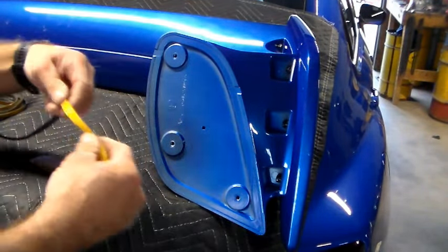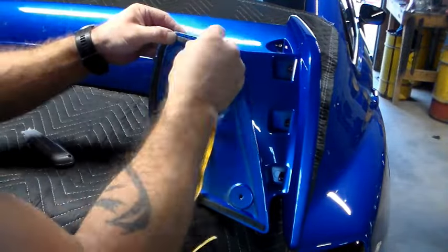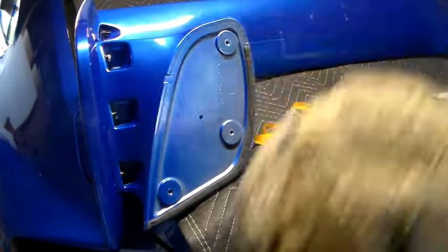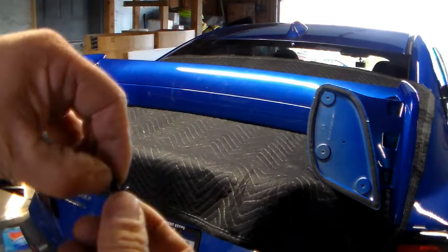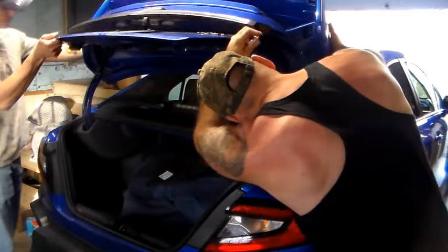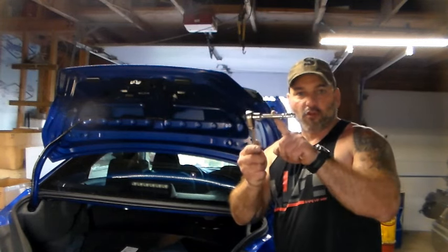Before bolting the wing down, we're going to apply the adhesive foam — best done in two pieces, up around the long side and then the other side. Once the foam is on, we're ready to bolt it down. The bolt order is crush washer then flat washer. For tightening, a 3 or 4 inch extension with a shallow 10 millimeter and a ratchet is the best way to go. Magnetic bits are definitely helpful — if not, have a magnetic pickup tool handy or you'll be fishing something out of the trunk.